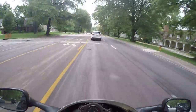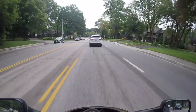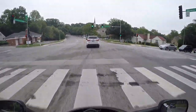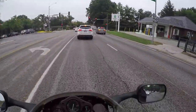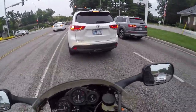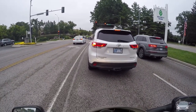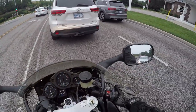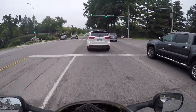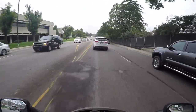One thing to watch out for when buying one of these CBRs is the brake light switch, especially on the front brake — they tend to go out fairly frequently. They're cheap to replace, usually about $10 from the Honda dealer. This bike is fitted with standard rubber brake hoses and the whole brake system is plenty adequate for the street. If you were to get it on the track you'd be wishing for more bite out of the front brakes, but upfitting some better pads and steel braided lines would probably get you more bite. From the street it's plenty adequate.